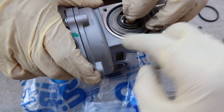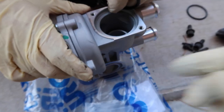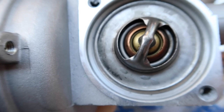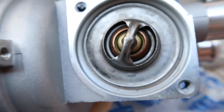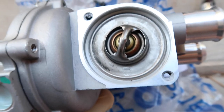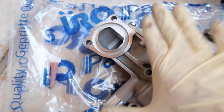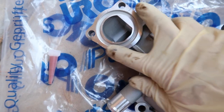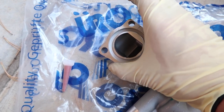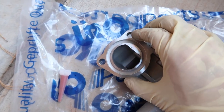For the 1990 Cabriolet timing cover — this is an eight-bolt water pump, and this is where your thermostat is going to go. You'll have your two radiator hoses on the side and then two bolts for the thermostat facing downwards. Before we go any further, we are going to add Loctite anti-seize to the threads for the 10-millimeter bolt. What this does is when metal expands, this will cause the threads to intertwine — the anti-seize acts like a hook so if we ever need to remove them again, it's going to be easy unscrewing. Right now we're putting red RTV gasket maker on there, then putting the gasket right back on top. We tried pre-installing it and the o-ring keeps falling out, so the RTV will keep it in place.